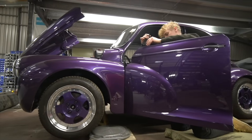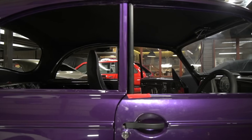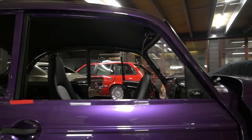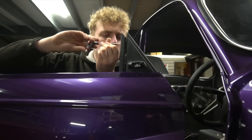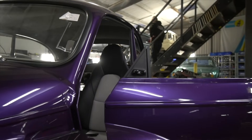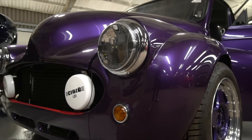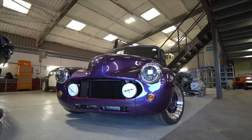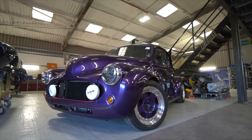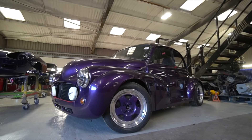Normally there's a divider and a separate quarter glass here, so this is not only a modified frame but a machined billet part to fill in that corner, mount it all, hold the wing mirror, and it's custom glass as well. George has been getting all that together, trialling the electric windows, making sure everything opens and shuts properly and that the windows go nicely up into their channels. There's still a little bit of tweaking to do and some seals along here. We're in the mock-up build to make sure it all functions properly before the final build where we'll apply sealant to make everything weathertight. It's looking very good - surprisingly, the combination of the black frame, single-piece glass, and handles has transformed it more than I thought it would.